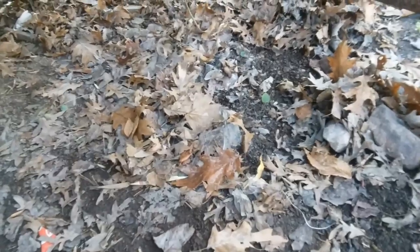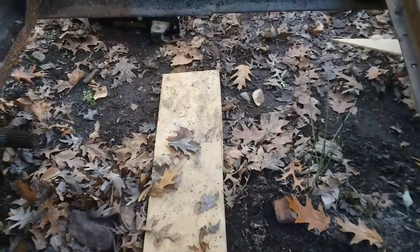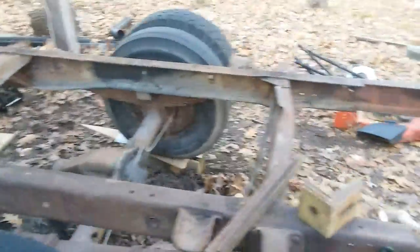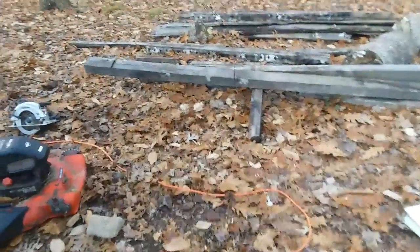We're dealing with not gravel or concrete — in some cases we're dealing with mud. So you have to use boards, plywood if you have it, that's helpful. But if you don't have that, you can do things like take the old stake side bed off of the truck and begin cutting it up to use as shim stock and bases for your jack stands.